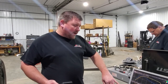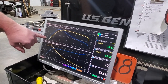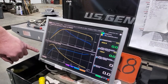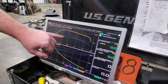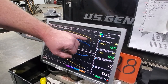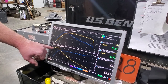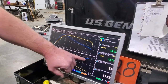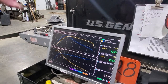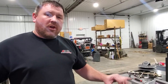Last night we did our baseline run with the tune that's equipped in the car, and this is just stock clutching. What we're seeing here is the yellow line - that's our engine horsepower. The blue line is dyno torque, so don't take that as actual engine torque. What we want to see is the horsepower curve. The other thing is the blue line here - this is our RPM profile. We've got the drive ratio set up, and we're going to look at where those two meet and how quickly we get there, then look at shift-out. We'll install the Ibex clutch kit and do the next run to see where all those lines correlate.